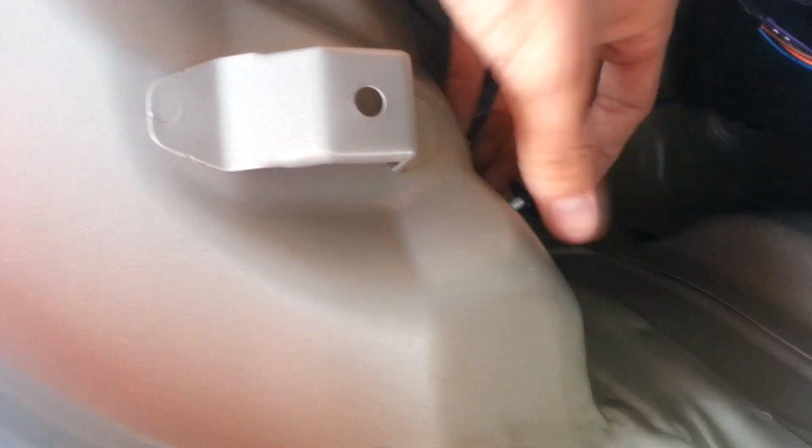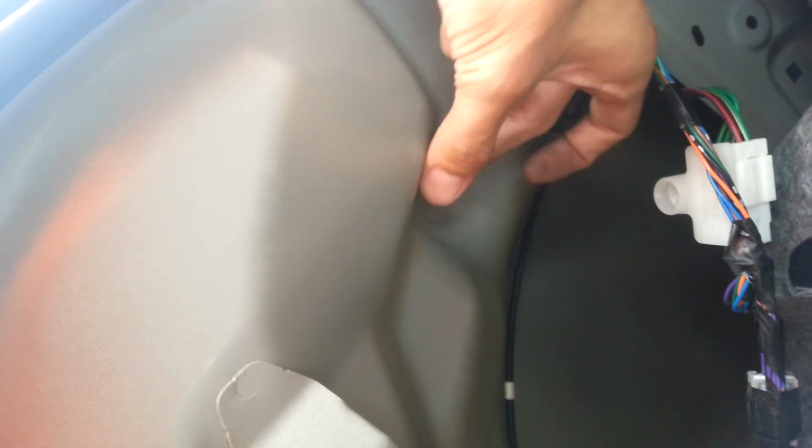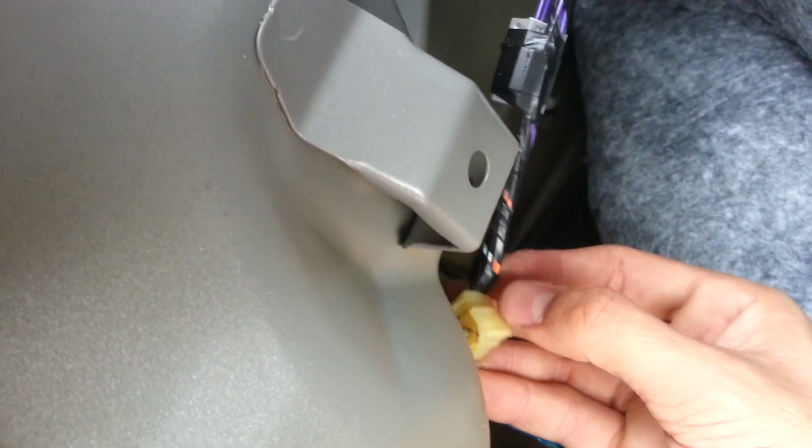This is the first time I take this side out, so it was done by the factory. They were put in fairly tight. I needed pliers. I recommend that, since this is really not a place where it's very exposed for you to lose these nuts. That's exactly what I'm going to do. I'm just tightening them up by hand pressure, and once you get those in, like I said, I just put them in by pressure from my own fingers so that I could take them out in the future. Then you're going to get these clips and put them back into place. You can hear them as they snap back on.